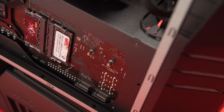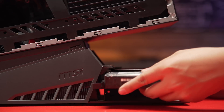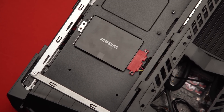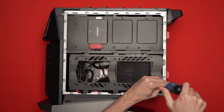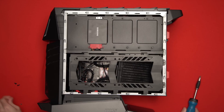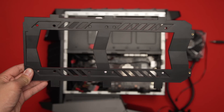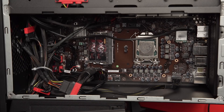Some stuff is handled well. Two of the DIMM slots and the two M.2 SSD slots are crazy easy to access from the side. The hard drives in the bottom foot have the cables pre-run, and the single 2.5-inch SSD on the side — though it annoys me that they didn't include hardware for the two others — can be installed in less than a minute. But the other third and fourth DIMM slots are on the other side of the motherboard, making them awkward to reach with the CPU cooler radiator installed. You'll need to remove the entire bracket to install your CPU anyway, and poor cable management with a lot of things needing to be moved out of the way is my biggest complaint down here.